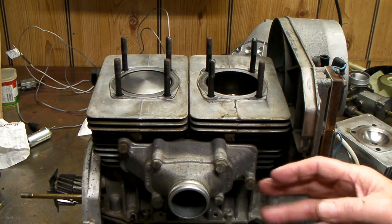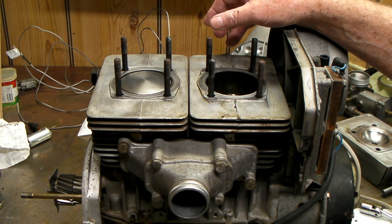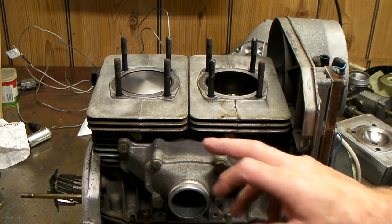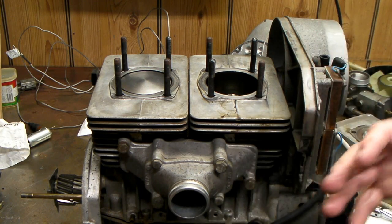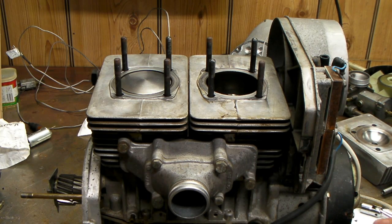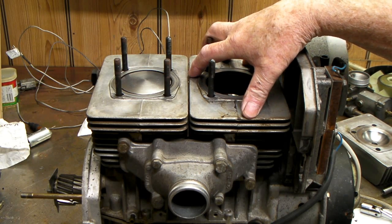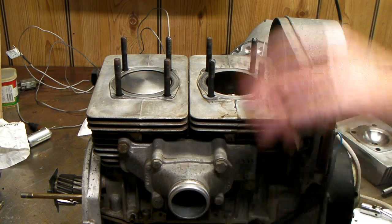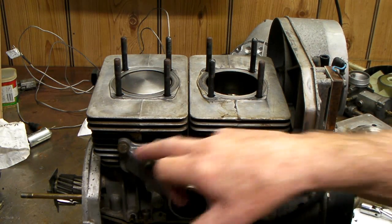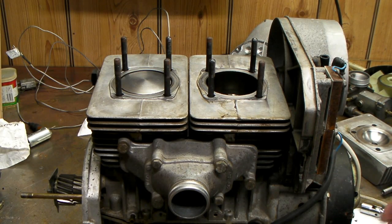Rotax has a special tool — just a plate that holds these things square. You could use the exhaust manifold, but sometimes exhaust manifolds are warped from heat. I like using the intake manifold for a single-carb engine. If it was a dual-carb engine I'd probably use the exhaust manifold. If you tighten the cylinders down crooked and then try to pull the manifold down on something that isn't square, you could actually warp it or even bust off one of the ears.